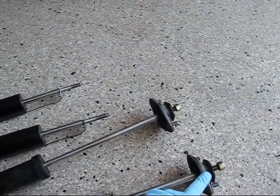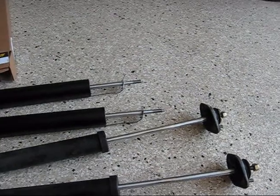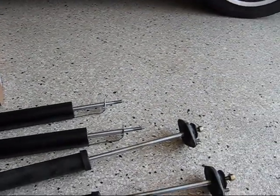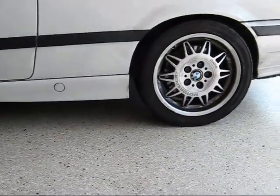These Monroes may in fact be an improvement over the original equipment shocks — that's debatable. I may have to transfer these little top seats for the shocks; that's no big deal. You can also buy new ones if you need them, but they're pretty much reusable unless they're damaged or completely worn out. These look good, so first thing I need to get the car up in the air.